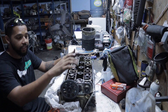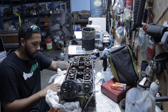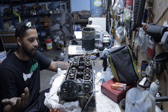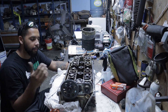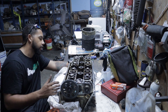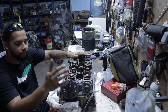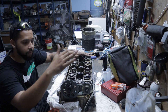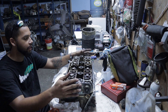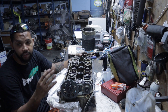The only thing I would have liked to change was the intake cam, because we all know the Cobra intake cam is the better cam. I have a few broken studs in here I'll pull those out, get the head cut, get it cleaned up, and do a valve job on it before we put them on — I want to make sure everything is working well. So the first thing you're going to need is the actual four-valve heads, complete with the cams, chain, and cam gears. You don't want to get them incomplete because buying these things piece by piece gets very expensive very quickly.